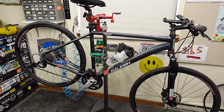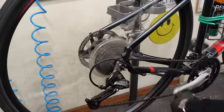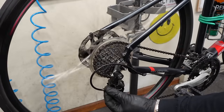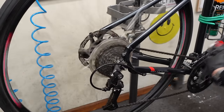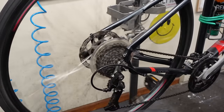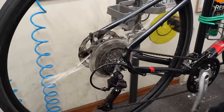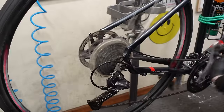I think the front derailleur is fine — that's my guess. Cable's a little tight, turning the barrel adjuster in a smidge. That helps it drop down. I could hear the chain rubbing on the derailleur, which told me the cable was still a little tight. I don't know how to explain that noise or how to detect it — it's just experience. Okay, this is acting a little funny; I think we're going to check the hanger and see how straight it is before we get going too far.